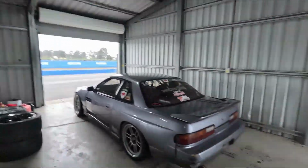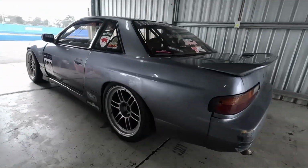We did try high boost. I'm very glad we did that in this one, because we were going to do it for the slicks, and we are now on the slicks for the next session. It didn't like the high boost, it was cutting. So we had to come in after the first lap and put it back down to low boost. Not even going to worry about whatever's causing that, it's probably just a limit set too low. But yeah, she's going to be fast, I'm keen.